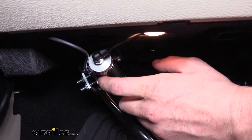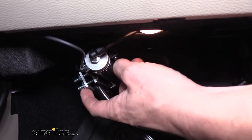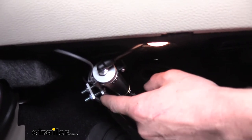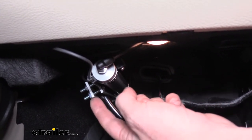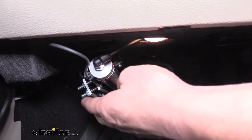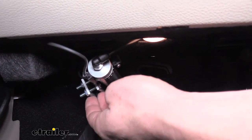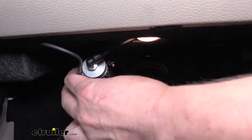Here on the inside of the vehicle we mounted our actuating cylinder to the brake pedal. The nuts just come right off. You take the other piece of metal that runs down it and clamp it around your brake pedal. When tightening these nuts down I recommend tightening them by hand — just use the socket with no ratchet and twist it by hand, because if you over-tighten it you could potentially damage it. When you check it by hand you'll feel when it's nice and snug so it won't knock off.